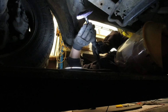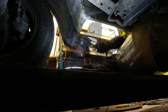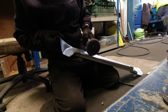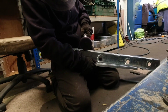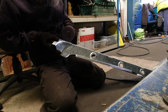The next morning it was back on the sill, where I'd forgot to do the other side of where we were welding. All the rubbery protective spray needed removing on the back because, again, it would just catch fire. Not a pleasant or quick job. Then, because I'd bought galvanised panels, everywhere that needed a weld going through it needed to be completely stripped back of galv as well. But as Paul said, it's all in the prep, and if you don't get it right, it just won't weld up. Honestly, I'm never complaining about how much welders charge.